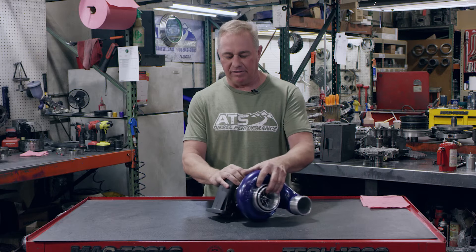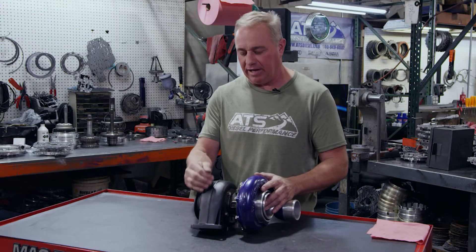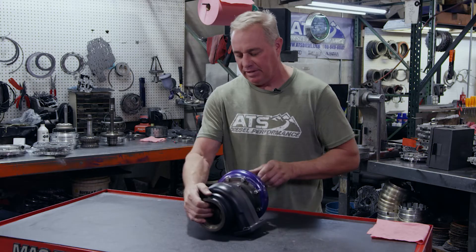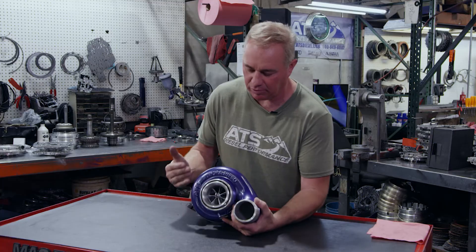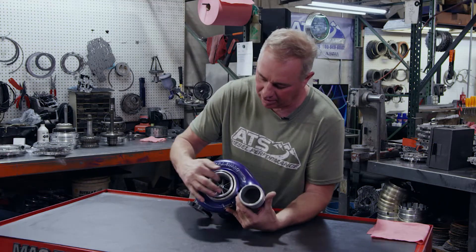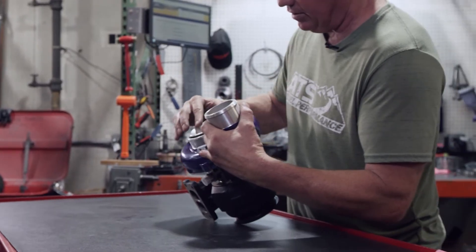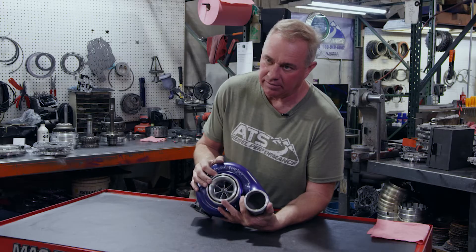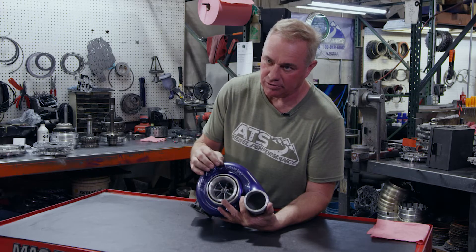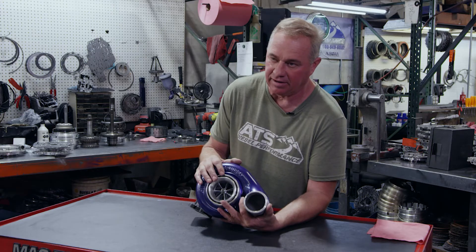Some of the dynamite features about this guy: not only do we have HSM compressor or turbine housing, bearing housing, Inconel wheel, but some of the really cool benefits you get from this turbo, just straight out of the package, is our inducer. You see the bell mouth inducer — it really increases airflow into the turbo. We also have our seven blade thin wheel compressor, which is across the board now on the 3000, 4000, and 5000.